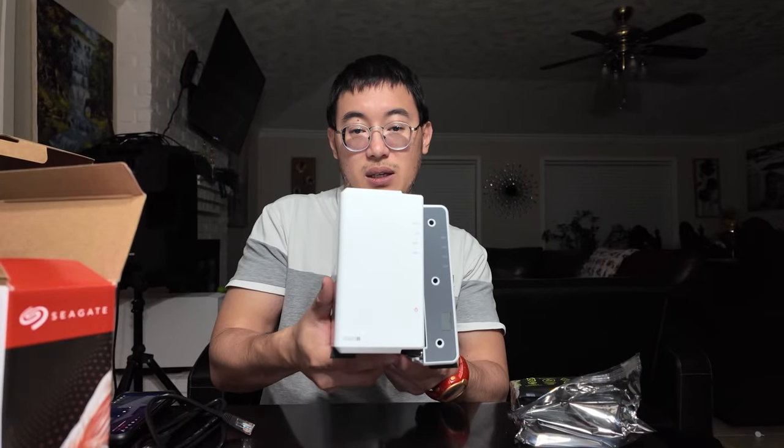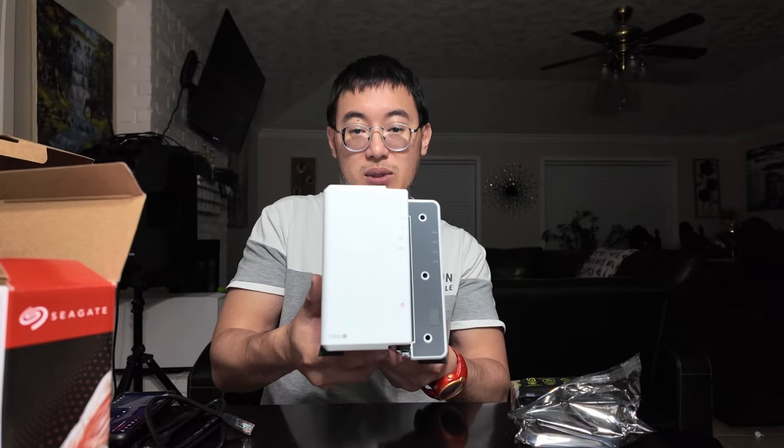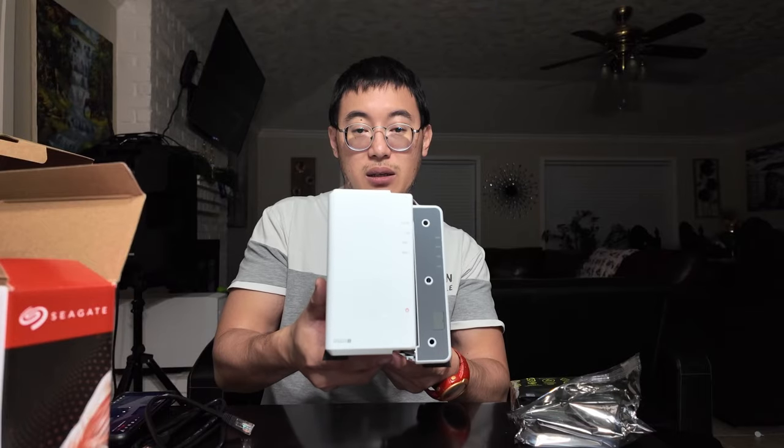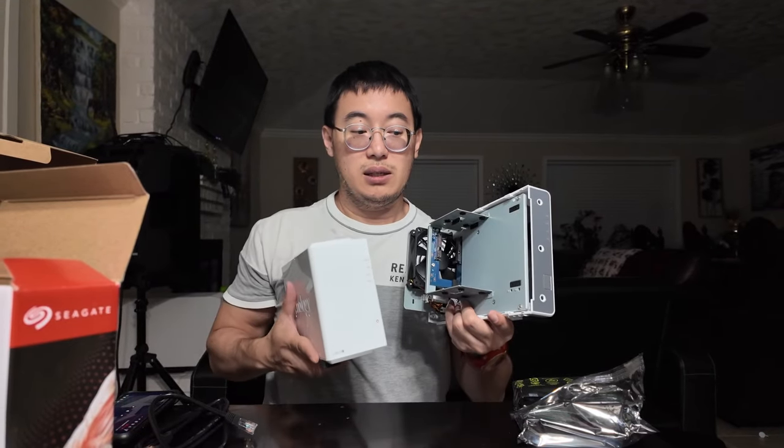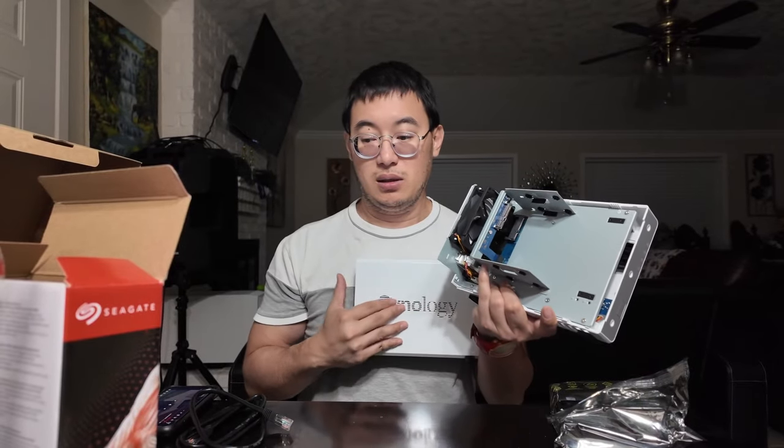I got the internal hard drive that I'm gonna put into the Synology. Originally it was like this. Hold the left side and then you just put your right hand and push forward, and it'll lock and you just pull out like that. So that's how you open it up to install the internal drives, and that's what we're gonna do now.